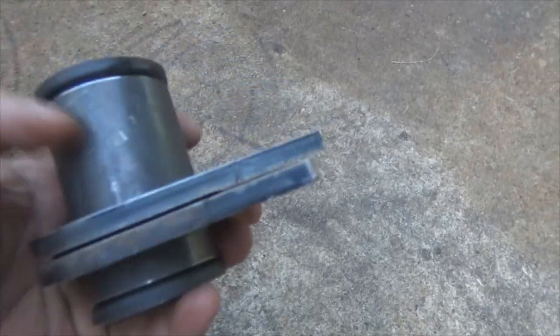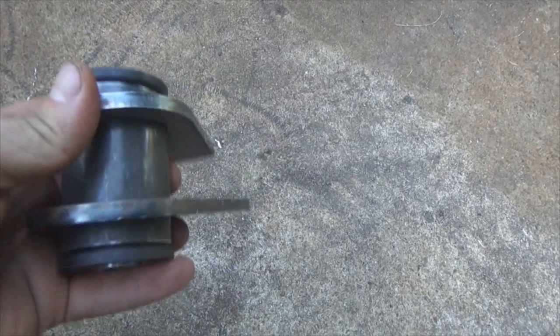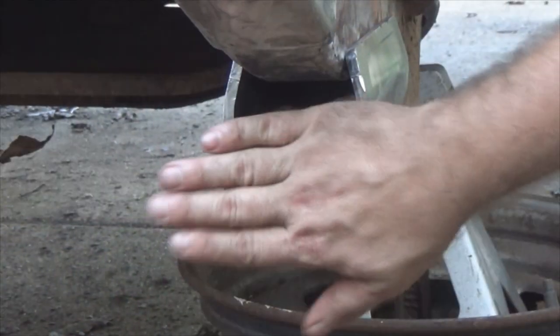Remember, in the back end I'll be doing these right here, so all I gotta do is offset my tube by that thickness of that quarter inch and then my leaves are back in line. Also, I'm doing an 8.8 conversion, so I'll be putting custom spring mount perches on it and can accommodate that as well. This is a full-on custom build, so me offsetting that a quarter inch doesn't hurt anything because I can offset everything else that quarter inch and make everything work as it should.